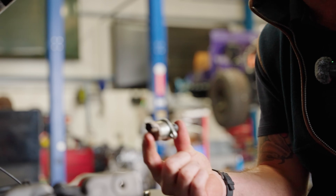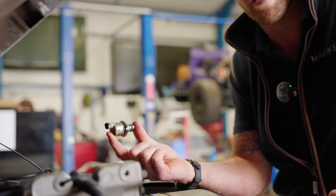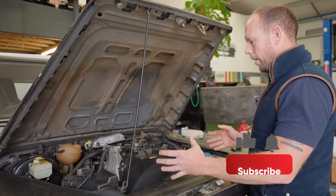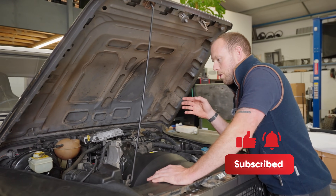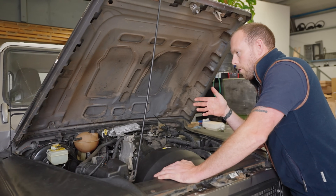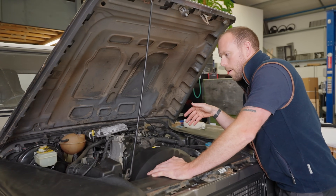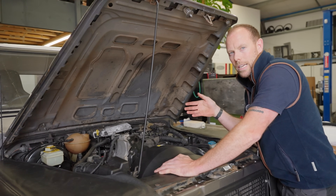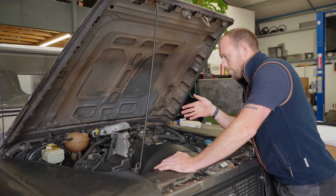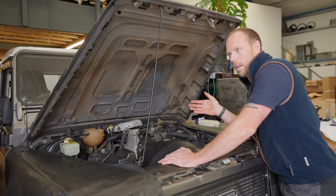Now the engine still doesn't want to run happy. We looked at the VCV valve that lives on the back of the fuel pump — these can go wrong, so we changed it. We went to do a pump learn but it won't let you do one unless the engine is at about 80 degrees. The problem is: how do you get a poorly running engine to 80 degrees? This vehicle has done 85,000 miles and we're two days in chasing problems and changing faults. The latest Autel diagnostics is telling us there's an issue with fuel pressure. Do we remove the high pressure fuel pump and send it to someone like United Diesel to be tested, rebuilt, and calibrated — probably two to three hundred pounds? We're nearly a thousand pounds in labour and parts, so the customer is probably approaching two and a half grand.